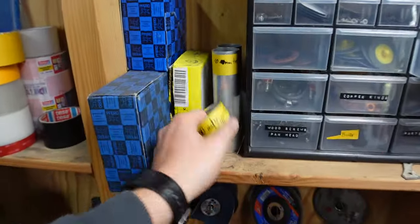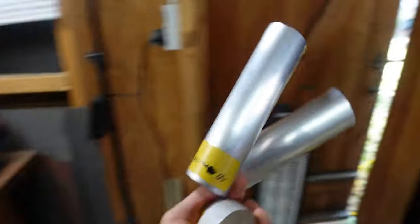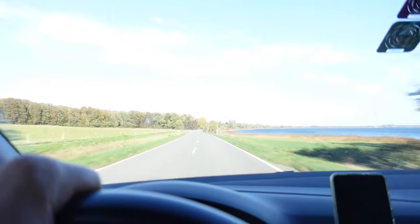The forks are gone on the BMW and I just got the call that we are ready to make the spacers to shorten them. So while I'm driving to my friend's workshop, let's use the time for some context. The BMWs had for their time relatively long front suspension travel which made for great riding comfort, but at the same time it makes the bike sit oddly high in the front, so we're gonna drop it.